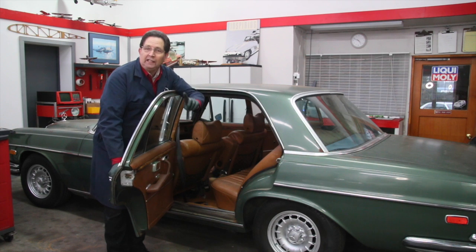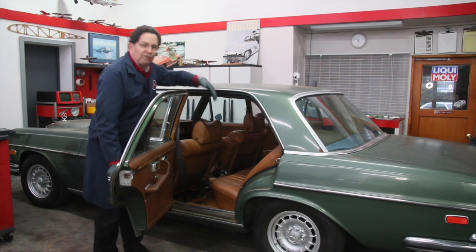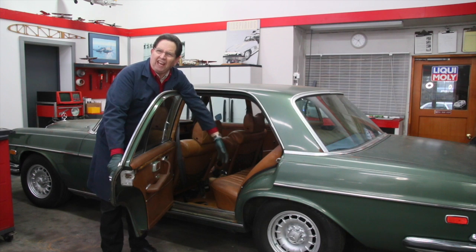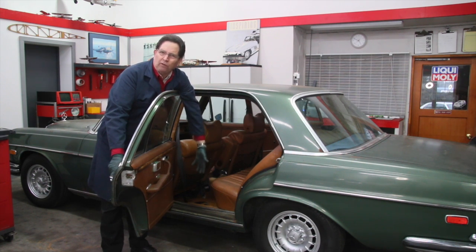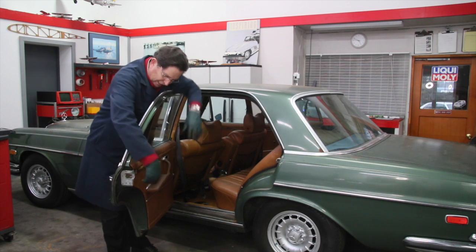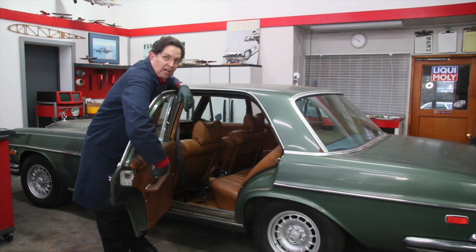And I've had one case where none of that helped. What I had to do is destroy the door panel. In that particular car, I thought about trying to take the whole door off, but even if you pull the front hinges, you've got this latch mechanism jammed, so you can't really get the door out far enough. So I had to say, okay, I'm going to sacrifice the door panel because I had to get the whole door panel off to get to the rods and to get way down in here into the lower part of the latch because the rod mechanism was not releasing it.